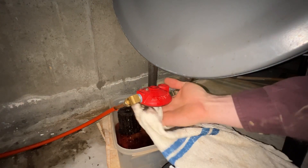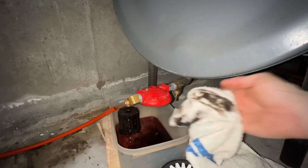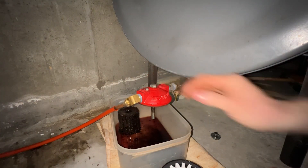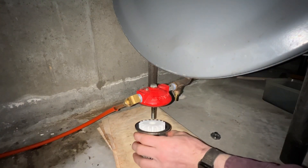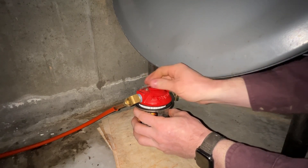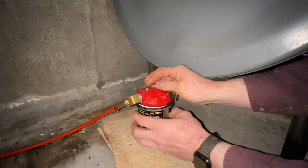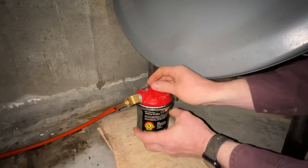Make sure the head of the filter assembly is clean and that there's no sludge to interfere with the seal. Drop the bolt back down — you can also remove the catch pan at this point if it's in your way. Slide the cup on with the new filter and start tightening that bolt up. Use your hands at first just to make sure you're not cross-threading.